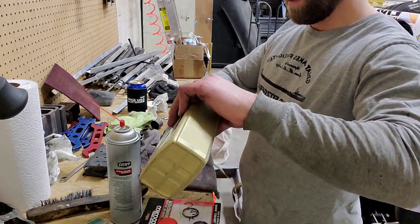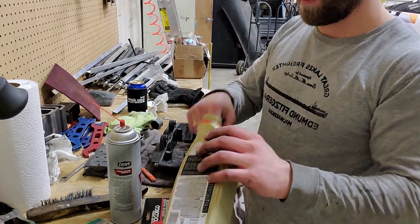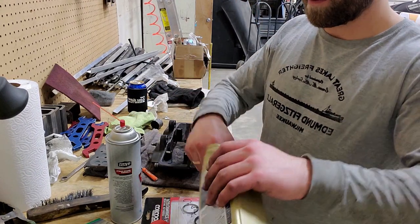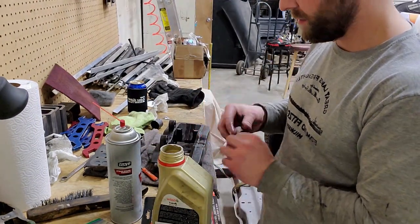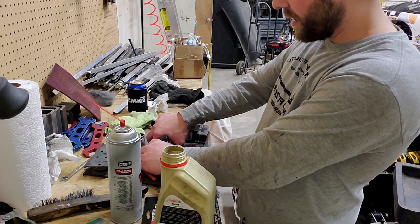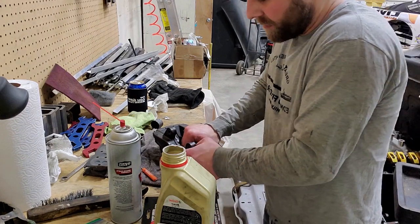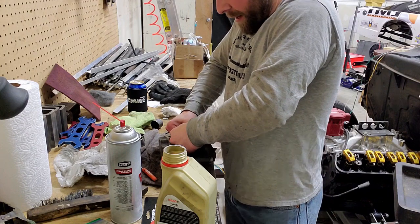I've been putting a little brake fluid on the new seals so everything slides really nice. These are actually called a square seal — they're not round like a rubber o-ring, they're square-edged. We came across a set of seals one time that were tapered on the inner bore and we didn't know that, so we put the calipers together and the first time we pumped them up they didn't hold brake pressure — something to look out for. This is our Castrol brake fluid, $85 a quart — brake use only. We got this one because it has a really high wet boiling point. The wet boiling point matters if moisture gets in there, so if you're not servicing your brake fluid every single race, this handles moisture absorption a little better than something with a higher dry boiling point.